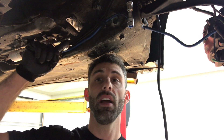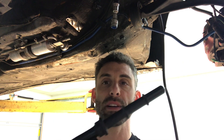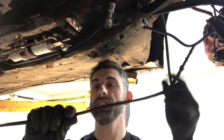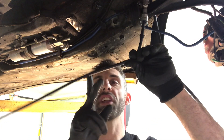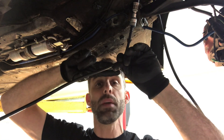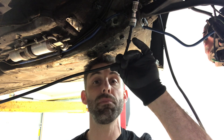For the fuel send line outside the regulator, this guy needs to connect to the fuel line that goes right into the engine — this is the fuel supply. On the E36, this cable has a special plastic hookup that pushes in and locks in place, then goes directly to the fuel line to the tank. I'm going to reuse that but in a slightly different capacity. I'll cut it here, put a tube from the outlet of the regulator into this tube going in pretty deep, and use a number of Oetiker clamps along the way to prevent any leaking in a high fuel pressure situation.